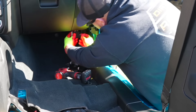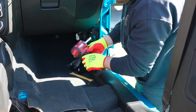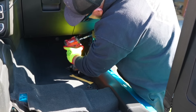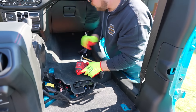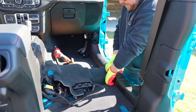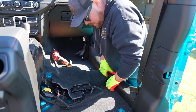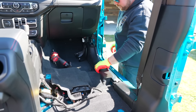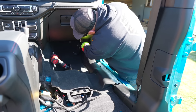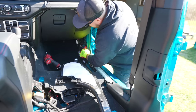I didn't break the harness connector — normally I do. We'll pop that off and there's a small 10 millimeter nut right here that we're going to pull off on each side. I like to set everything in the cup holder so I don't lose it. I am wearing gloves — a lot of people give me grief for it, but you want to get a good grip when you're pulling this stuff off, and it's really sharp too. Ryan has seen me cut my hands on these Jeeps many times.